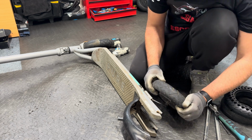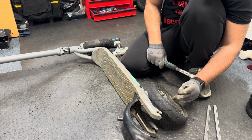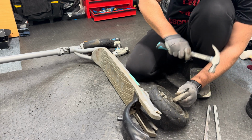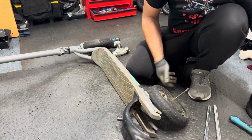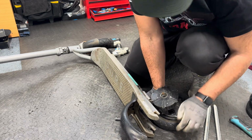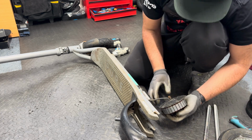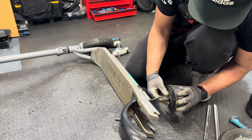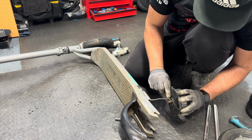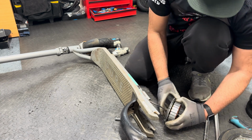Okay, once I do this, I'm taking just this pin and sliding it in the opposite direction, and I'm gonna bump it a little bit so I can take the axle out of the bearings. Once I've done this, I'm just gonna push down, up, and I'll take the rotor out. Yes, just like this. Well, the motor looks very good inside, but as you can see, the wire in here, because it was twisted, it kind of damaged the sleeve at the top, but not the wires inside, which is very good, because the motor still works perfectly.